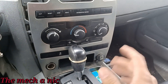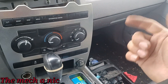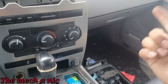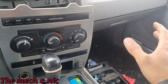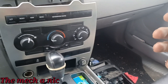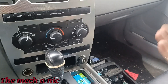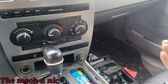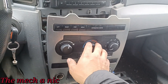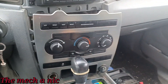The owner is going to be super happy. Honestly, I'm not charging her for this repair. When she first brought it to me I saw the burned wires on the blower motor and the resistor, and that's why I said we've got to change out those pigtails as well as the new blower motor and resistor. After I did that and the parts still wouldn't work — I feel horrible for the owner because they dumped money into this trying to get it fixed, only to hear there's something else wrong. So I told her: bring me this part and I'll install it for free.